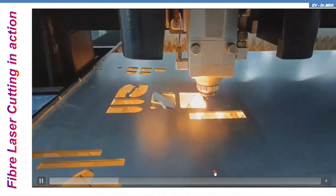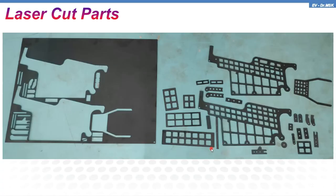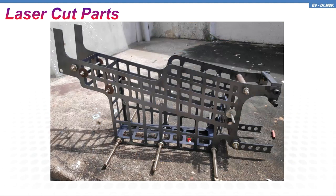This is how I made the parts for this EV. After making the cuts, you can see these are the blanked parts made out of the mild steel sheet. This is one side of the frame of the vehicle, and this is the other side. Fabrication is underway — I join all the frames and this particular arm for the swinging member.